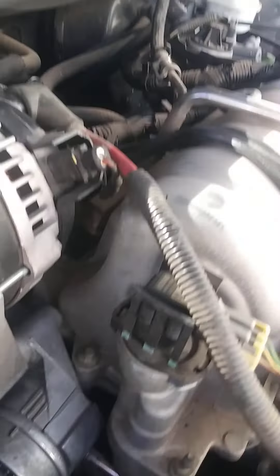That's the elbow right there, and that's that one bolt I was talking about right here — that's how that one looks in there. Wherever you see the RTV, that's where you want to put the RTV. I put some RTV on these too — I didn't get a new gasket, I just put RTV in there and it sealed up pretty good. Everything's working fine. Like I said, this is three days later. This is for the 3800 Series 3, 3.8 liter.